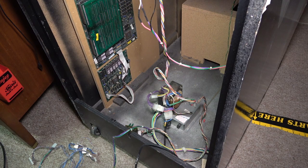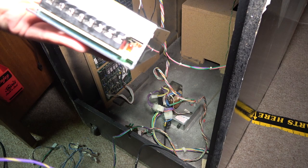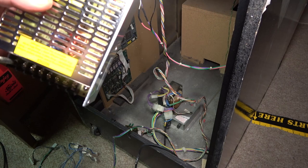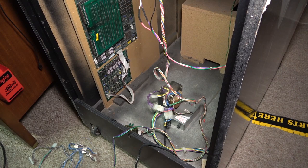So it's all labeled, you know, AC, field ground, ground, ground, plus 5, plus 12, and minus 5. Now, the order of these does not match what was in the manual, so you got to be careful of that, because this power supply has a different pinout, whatever you want to call it. And in fact, let me grab the...